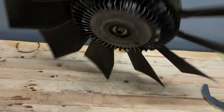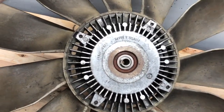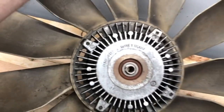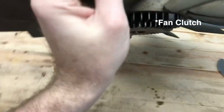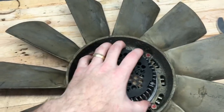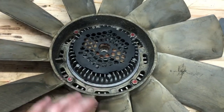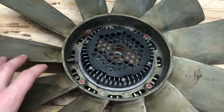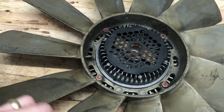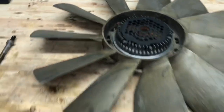So if I turn it over, you can see those 4 tabs, and you can see the bolt showing through there. So this will slide off, leaving the fan attached by that 8mm hex bolt, by this one, on the car. And you can slide this out between the radiator and the fan clutch. However, it is very tight, and you run the risk of bending some of the fins on your engine, and I'll show you kind of what you might run into.